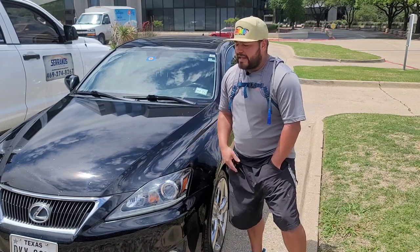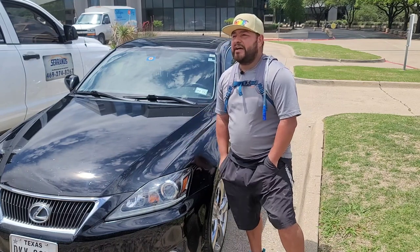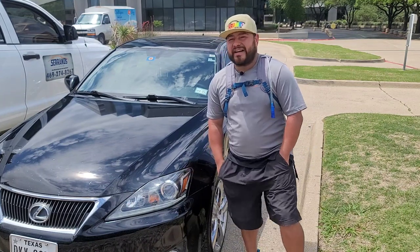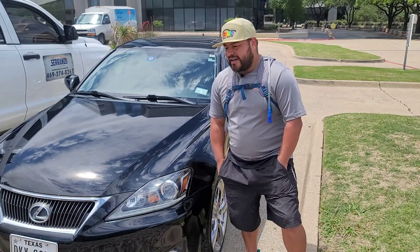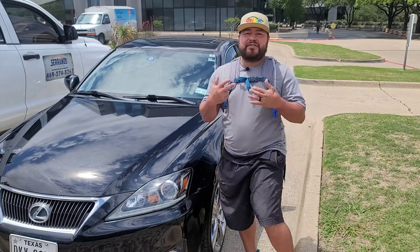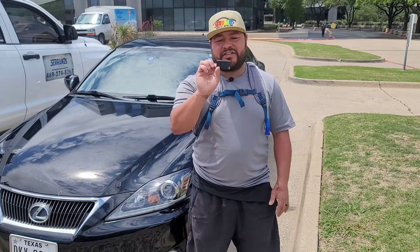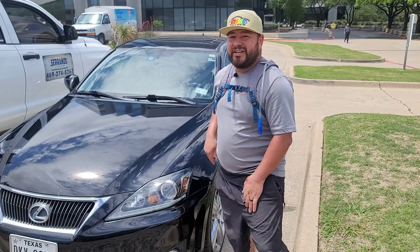The cost today is $150 for both headlights — sanding them down, polishing them out, and applying a coating. Some others will spray a clear coat on it instead. Some of you may ask whether it will get oxidized again — the warranty I give customers is: if at any given time your headlights start to deteriorate or look dull, just let me know and I'll gladly take care of them. After this process, we'd just need a quick polish. I do this work outdoors as always, and I highly recommend getting yourself some sanding blocks — you can get them from O'Reilly's or anywhere really. This truly helps you maintain an even sanding, because if you sand with your hands or fingers you're going to get different patterns.